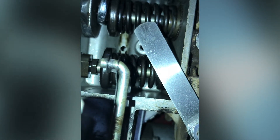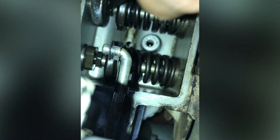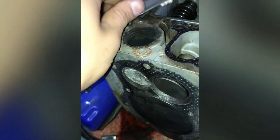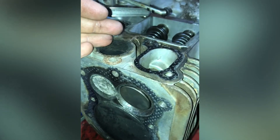It goes in there. What we're going to do is tighten it up as much as possible but still be able to put that feeler gauge inside there. We don't want it to be tight on it; we just want it to just slip in and out — just a good fit. Then do the other one — your exhaust — and if it's a two-cylinder engine do the other side. The exhaust normally has a larger valve lash, so if it just gives you two numbers, do the larger number for the exhaust most of the time.